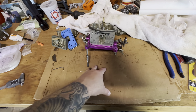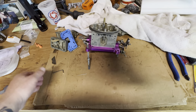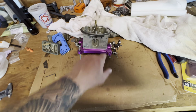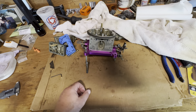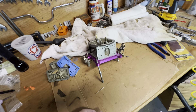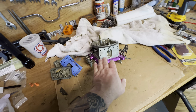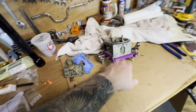Then you've got a replaceable jet. If you're really brave when you're starting these projects, cut it down 25% — make your hole 25% smaller — because then you don't have to make another jet. If it's too small and the car doesn't like it, you can just pop these out and drill them four thousandths bigger, three thousandths bigger, put them back in. Still doesn't like it? Drill them another two or three thousandths and put them back in. Instead of punching it out to 70 thousandths and then needing a 65 — because you can't make a hole smaller. I thought about brazing one and filling it, or epoxying it and re-drilling it, but I don't want to lose a piece of epoxy into the port. I'd recommend making a big step and working up with drills to find the right size.